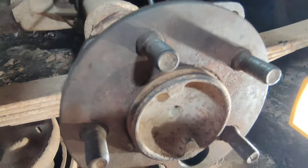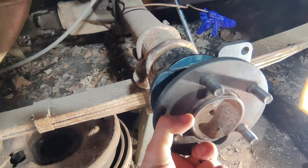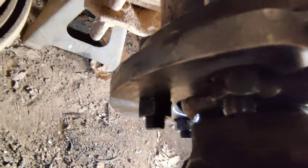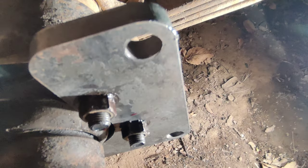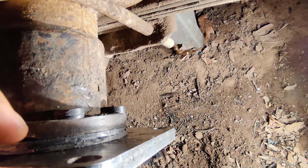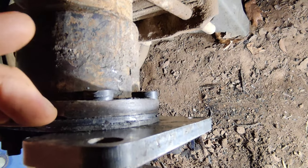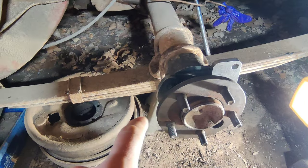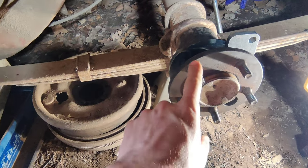This is all fully installed now. Went ahead and bolted these down at 50 foot-pounds each. Not really sure if that's too much or too little, but it seems like a good healthy ratio because I got it tight by hand and it could take a little extra. So looking at that seal, the way Vlad created these, that is a pretty good tight seal all the way around.